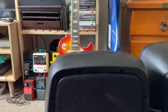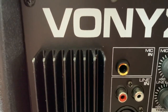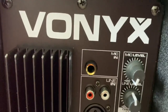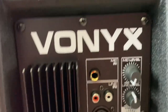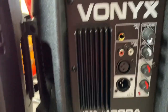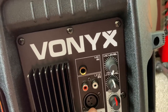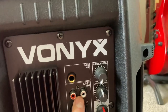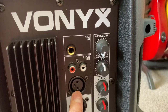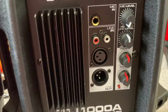It's made out of plastic, but not any cheap plastic — they're actually fairly good. At the back, the inputs and outputs include a mic-in. I haven't tried the mic, so I'm not sure about the sound quality, gain, or noise level. My mic usually goes to a submixer then into the PA anyway. For line inputs, we have RCA and an XLR. The RCA with left and right, even if you put that in, it sums to mono. With the XLR, it's definitely mono — just one channel.